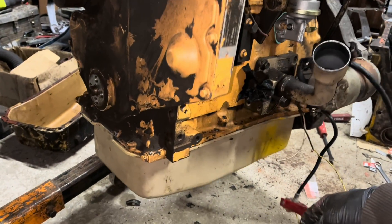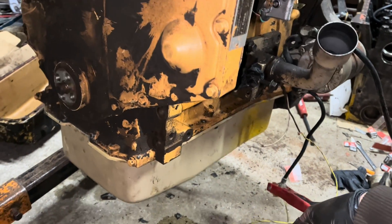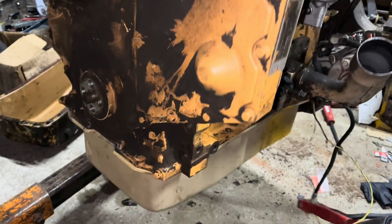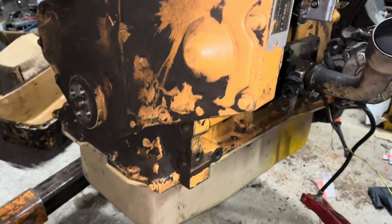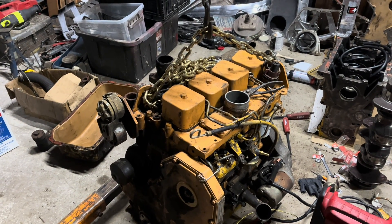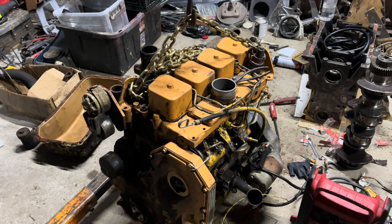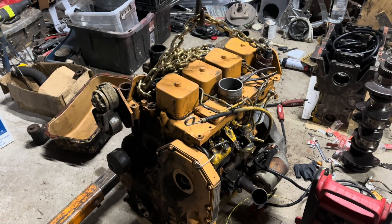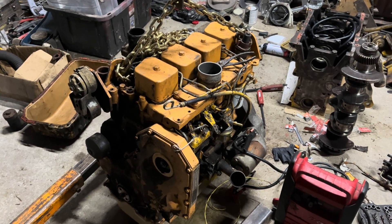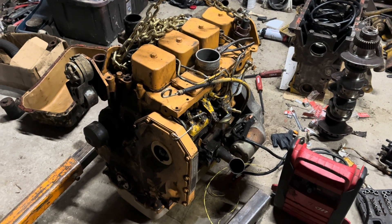Ground! It's doing a happy dance. Sounds like I've got a leaky intake valve and that's why it's speeding up on one cylinder. Definitely need some more juice to crank this thing over, but I might have to dig into the covers and see if maybe it's an adjustment issue or if it's something else not so good. May as well crank some more oil pressure into it and see what happens.